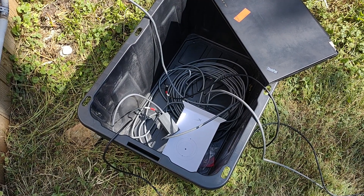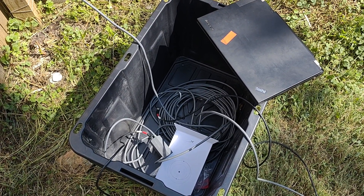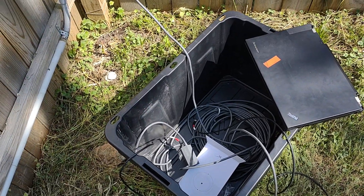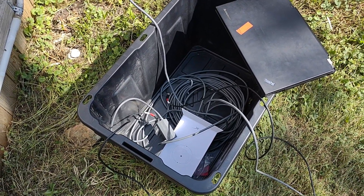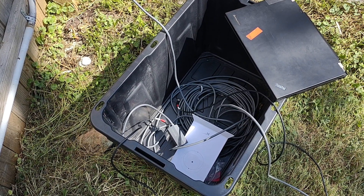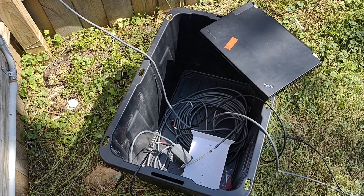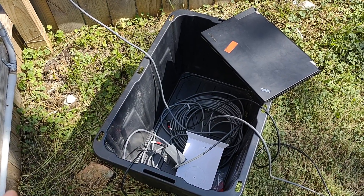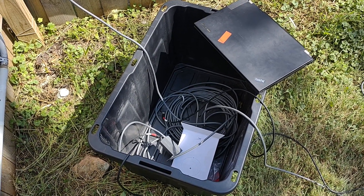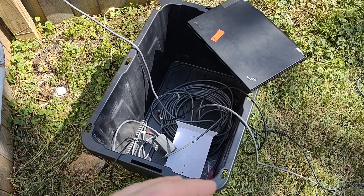I originally thought it could have been the inverter that killed it because of dirty power — it's a cheap Harbor Freight inverter, though it works on laptops and other stuff. But I do understand this is probably more delicate equipment than a laptop. Unplugging the Ethernet adapter fixed the issue, but when I plugged it back in again the system wouldn't come back. I kept flip-flopping between the two to scientifically confirm the issue. With just the dish and router, it would come up in less than two minutes. With the Ethernet adapter plugged in, it wouldn't do anything. I restarted it, went back to just dish and router, and it would come back up.